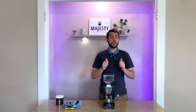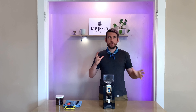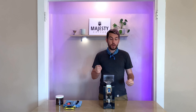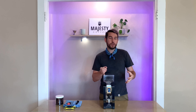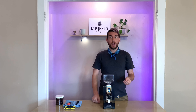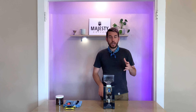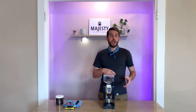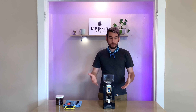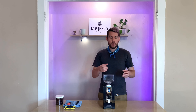The first thing you want to do whenever you're experiencing grinder issues is stop grinding coffee — perhaps even switch off your machine entirely based on the severity of the situation. Next, in most cases you can potentially fix the problem by moving your grinder into a very coarse position. We should always make adjustments when running grounds through the grinder, and if you made an adjustment a little bit finer when there weren't grounds coming out, you might have gotten your grinder stuck.